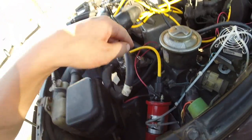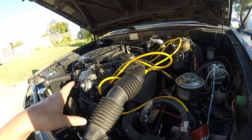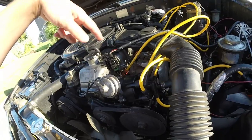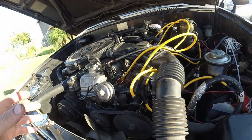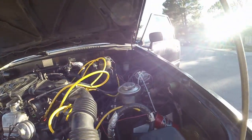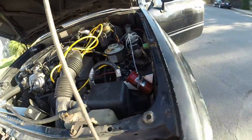Now, because you have a performance ignition coil, I went with performance ignition wires. They recommend that with this whole setup you use upgraded wires, because the stock wires aren't rated for that amount of voltage. Also, since I had the whole setup apart, I pulled out all the spark plugs and put in new ones. They recommend you gap your spark plugs to 0.040 to 0.045 — with 0.045 being the widest you'd want. This setup generates a much larger, more powerful spark, so you want a wider gap to let it burn longer.